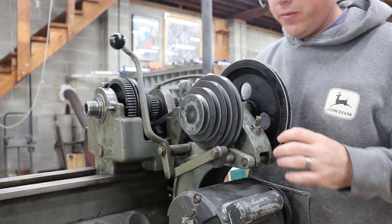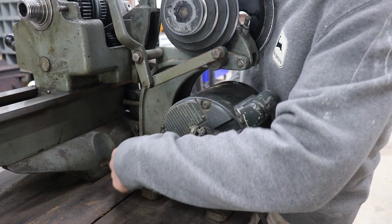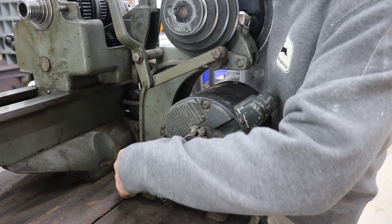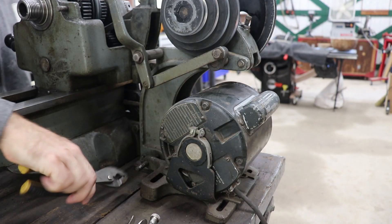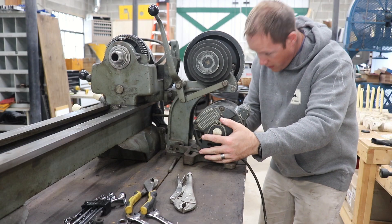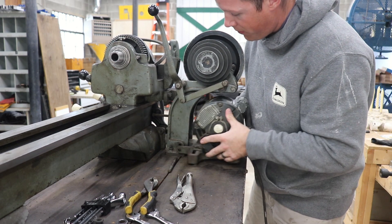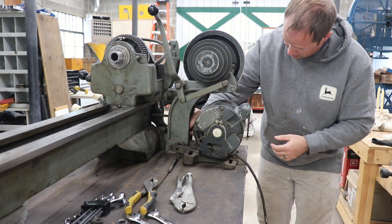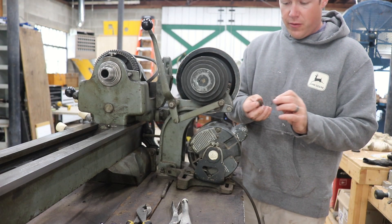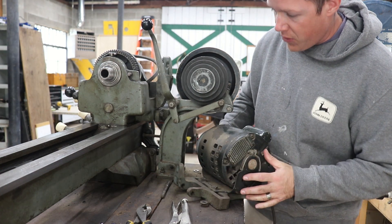Now we're going to move on to removing the motor. To remove the motor and motor mounting plate I need to pull this pin here — it looks like it's already partially slid out from the other side, so we're just going to grip it and try to pull it out. It looks like there's a tensioning bolt of some sort in here that's preventing this assembly from detaching, so let's work on that. It's just a knurled nut and a washer, and now we're free. There's the motor and the motor mounting plate.